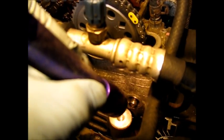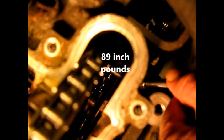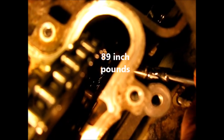That's just impossible. I'm just trying to get it into the slot. Taking a peek down in there — it looks like I've got it. Now I'm going to put on a universal and then a little extension to torque this thing down. Okay, we've got this torqued, reaching through the hole there — 89 inch-pounds.